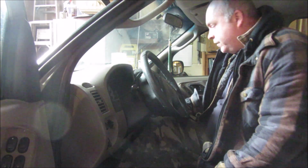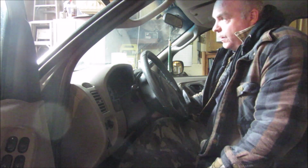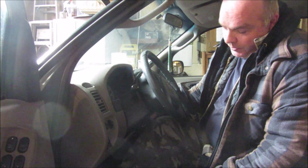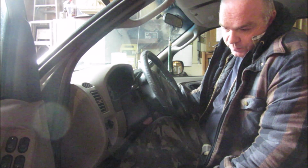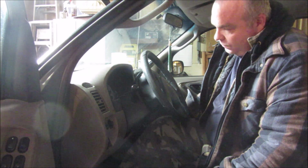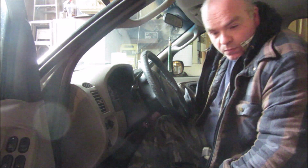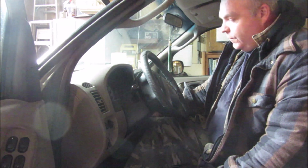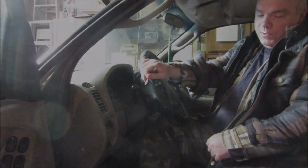We're in the 01 Ford Escape here, and the brake booster is dying. Hopefully you'll be able to hear this. I'm going to start it up real quick, just so you can hear it, hopefully. You probably can't hear that anyway, so we're going to bring you down here and show you. I'm going to try and start it one more time and see if you hear that noise. It should be an air rushing noise.